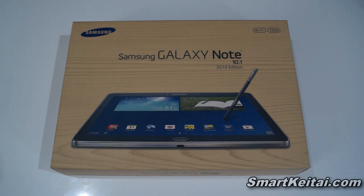The second generation Galaxy Note 10.1 is rocking a 10.1-inch WQXGA Super Clear LCD display at 2560 by 1600 resolution, an Exynos 5 Octa processor comprised of a 1.9 GHz quad-core chip plus a 1.3 GHz quad-core chip, 3 GB of RAM, up to 64 GB of internal storage with microSD expandability, an 8 MP rear camera, 2 MP front-facing camera, an 8220 mAh battery, an improved S Pen stylus, a textured back cover with stitching, and Android 4.3 Jelly Bean with Samsung's custom TouchWiz UX.